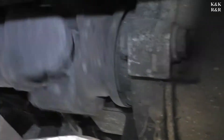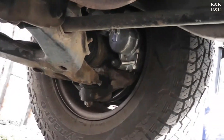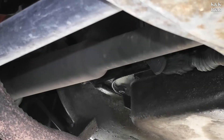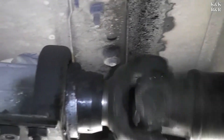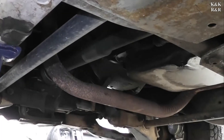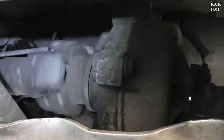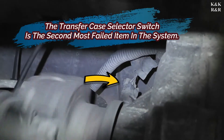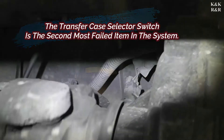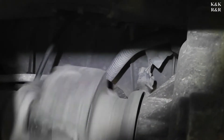As you can see here, the transfer case is indeed sending power, but if you look at the wheels, no power is getting to the wheel. No wheels spinning in the front. At this point we've confirmed that it's a front differential issue. Right there is the transfer case switch that engages the front four-wheel drive actuator. It's kind of a pain to get to, but most of the time those don't go bad — it's always the unit in the diff.